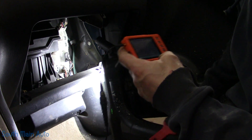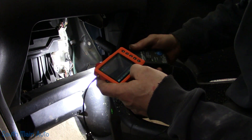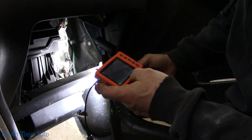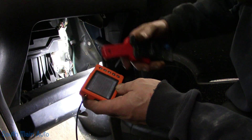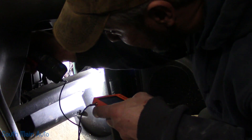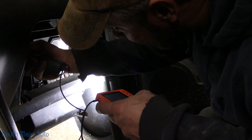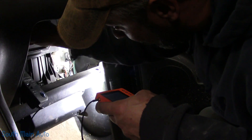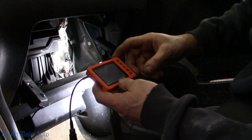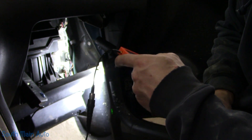He had it all torn apart like this in an attempt to look at it himself — doesn't know what's wrong with it. What I want to do is grab the U-scope. Let's say this motor has a dead spot in it. I've done another Quick Tip video where we used a test light to see power going into the motor and coming back out on the ground side, turning it slowly by hand to find that open spot. Theoretically, we should be able to do the same thing with a current clamp, just like we would on a fuel pump with an intermittently dying fuel pump. So I'm going to hook the clamp around the wire that goes to the blower motor and kick it on.